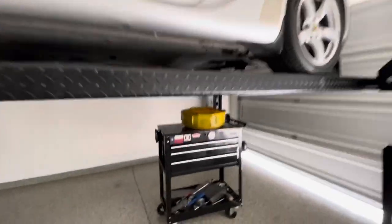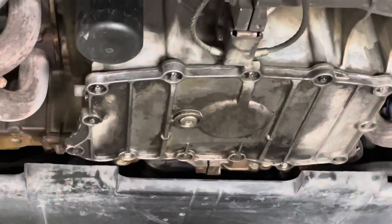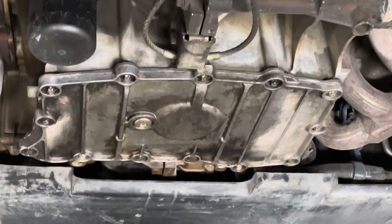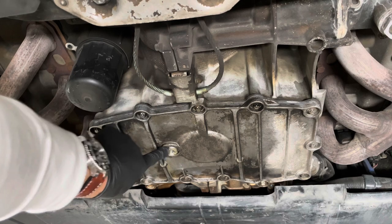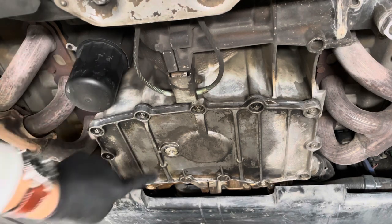So now I'm going to go under the car. Hopefully you have good visibility now. That is going to be the area where you're working on today. This right here is going to be loosening up — this is an 8mm bit. This right here is going to be the oil filter housing, so get a tool for that and we'll go ahead and crack this loose.